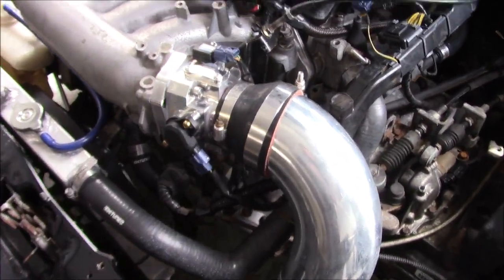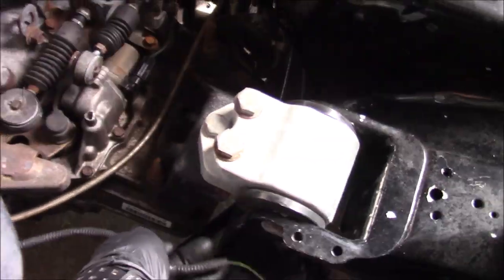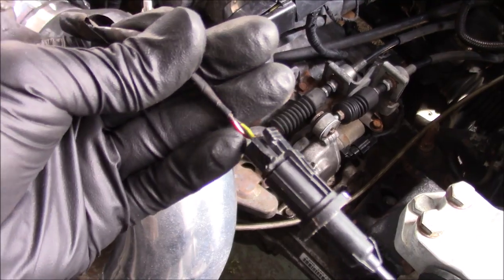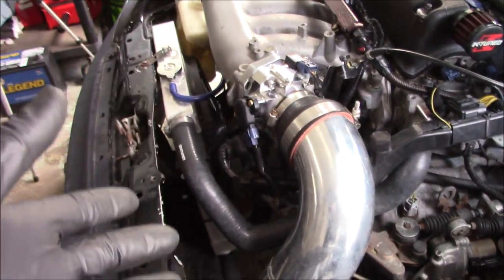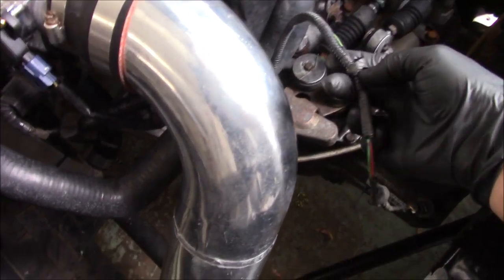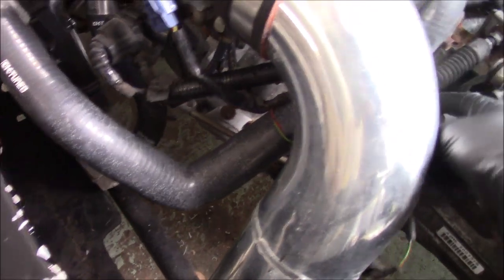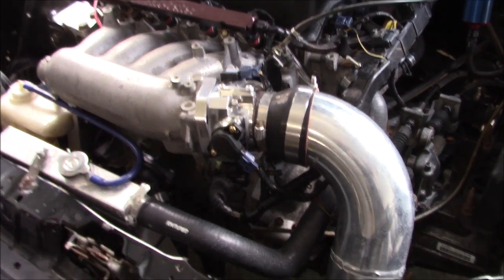Our intake is on there. Another thing he wanted me to do is wire in this new pigtail because his IAT was just kind of hanging around anywhere and the connector ended up busting — probably dragged on something. No problem, I'll take care of that. But since he had it just hanging, I want to put it where it belongs — into the pipe. So we have all this extra wire. I'm going to cut it a lot shorter since we're splicing something new in there, and make a mark back here on the intake where you can't see it and put a hole in here with a grommet. That way he can actually put the IAT into the intake — it's really hidden, a little tucked, and done proper.